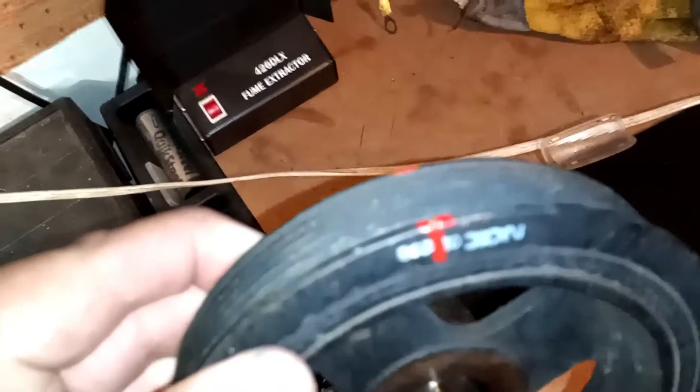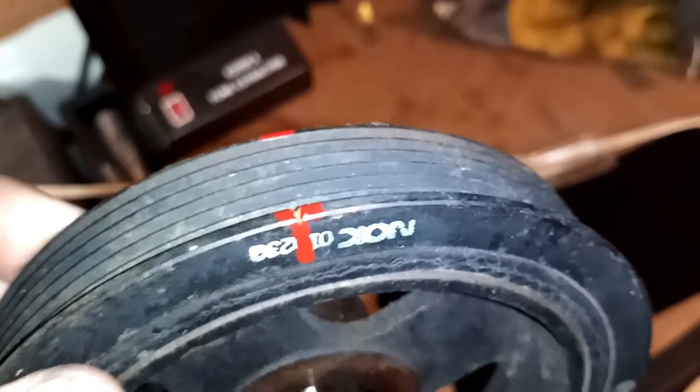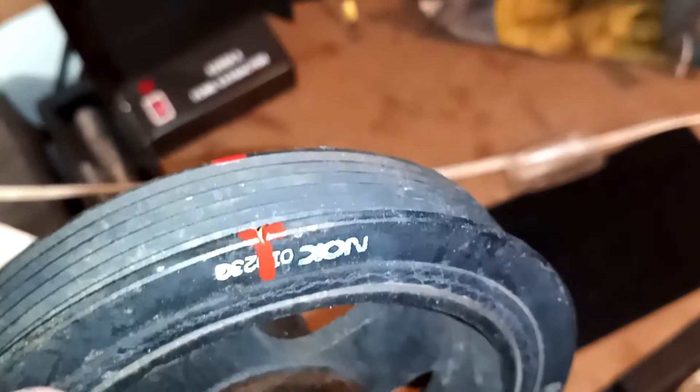Put some paint on this to make it a little easier to see — there's the timing mark on the crank pulley that lines up to the timing chain case. Next time we're going to put this in line, and then we have to take out the timing chain tensioner before we take out the timing chain case. That'll be next time.